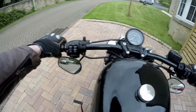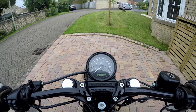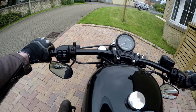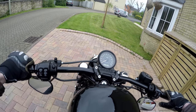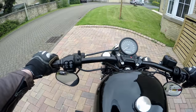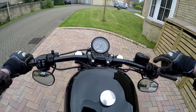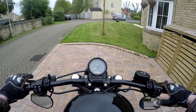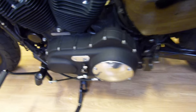This is basically the problem I had. If I'm in first gear with the side stand down, I drop it into first and I get this message — side stand down — the engine cuts out. The problem I was having is that this was happening even though the side stand was up. In fact, there you go, it just cut out — side stand is the issue — and the side stand is actually up. The sensor isn't correctly detecting it. I'm going to get the camera under the bike and show you the problem.